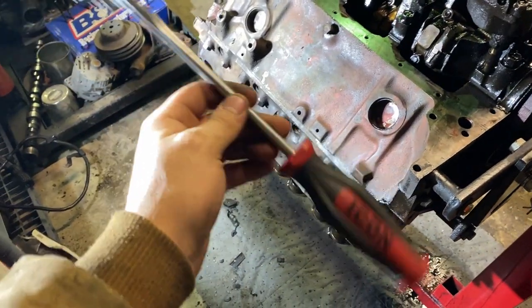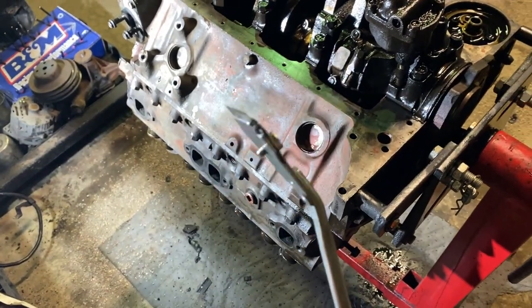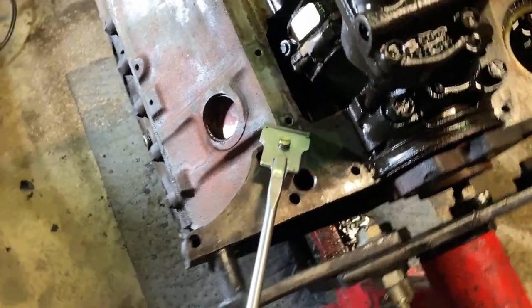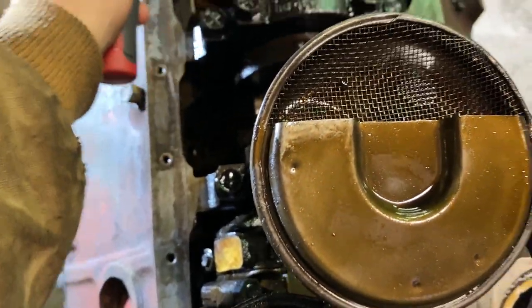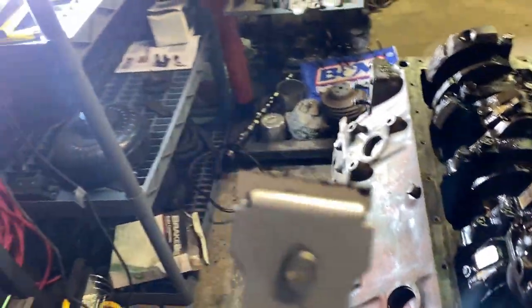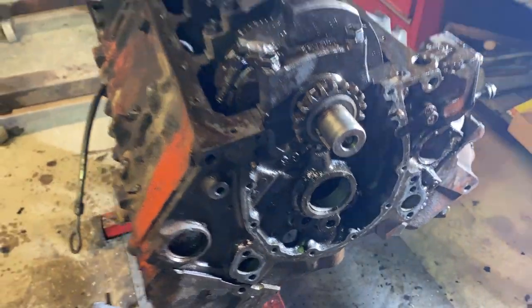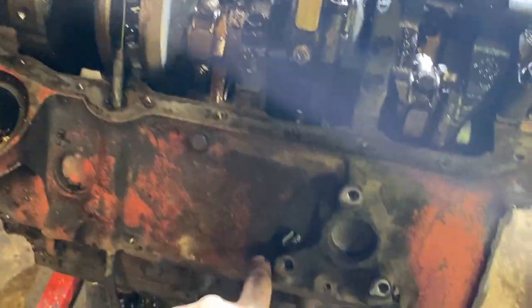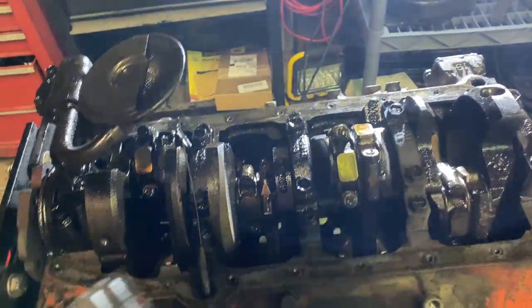Just want to say no, I'm not sponsored. Icon Tools makes this really nice blade holder — this thing works really good for scraping surfaces, especially on the oil pan. I'll just run this fresh blade right across the oil pan rail. Now it looked pretty clean — look at the crap it picked up. Works really good for scraping gaskets off. I used it up here on the timing cover as well as the oil pan rail. I'm going to get this stuff cleaned up, get my debris cleaned off, clean out any debris that maybe fell on the cylinders, and wash this with some brake clean.